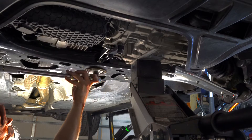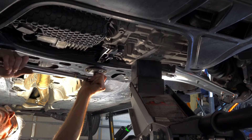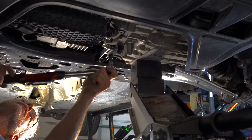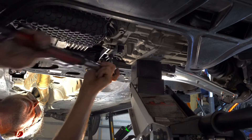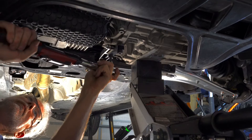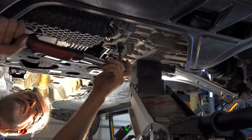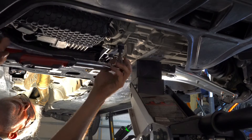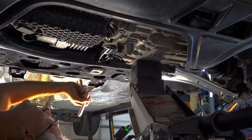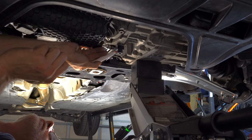The torque specs were probably the only thing I really had to look up. The torque on the 15mm bolt is 74 foot-pounds, and then the two 10mm Allen bolts on the transmission side are 54 foot-pounds. Torque down the subframe side and then the two transmission side. I'm using a paint pen like I usually do to mark that I've torqued them down — it's a good visual indicator, and I can look at it later to see if anything's turning.